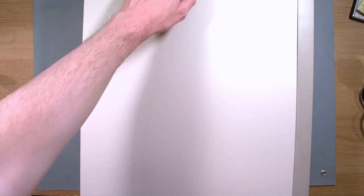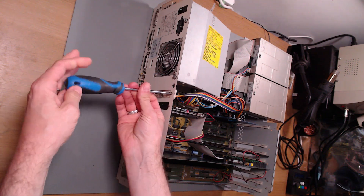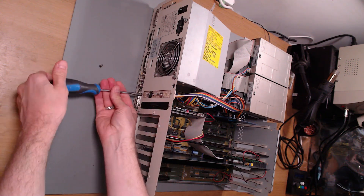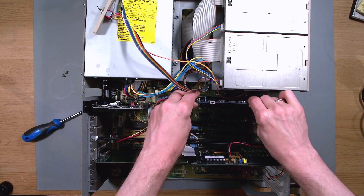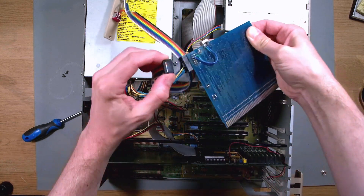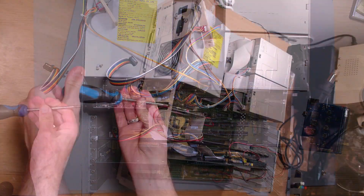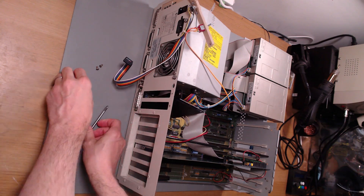So I think the first thing I'm going to do is just install the card and see it working. Now I currently have the action replay cartridge installed in the CPU slot, so I'll have to remove that. And I'll also have to think about that dual boot kickstart ROM switch too. I've already unscrewed the lid and opening it up we find where we left off last. I'll start by removing the plate with the kickstart and action replay socket on it, as this is where the card will need to poke out. To make installing the card a little bit easier, I'm also going to make a little bit of space by moving the bracket holding the blue SCSI.